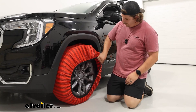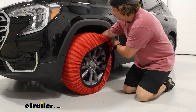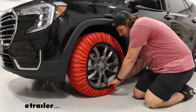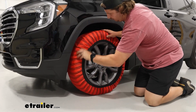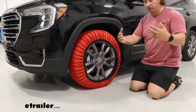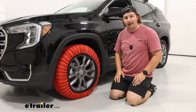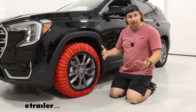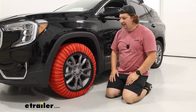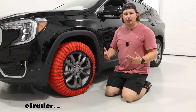Once you've driven forward a little bit, it's just a matter of stretching that snow sock over the rest of the tire and trying to get it even front to back — and right there is looking pretty good. Since you have to move the vehicle forward during the install process, I'd recommend doing both sides at the same time. Once you have both sides installed you're ready to go. Start driving and maybe after a couple feet just come out and check on them to make sure nothing slipped, and you'll be ready to hit the road.